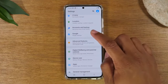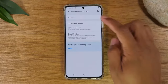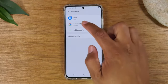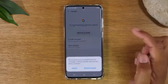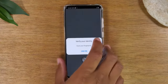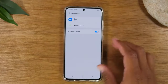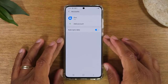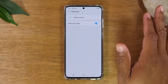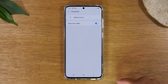From here, we're then going to go to accounts. Look for your accounts and backup tab here. Tap on accounts again. Any Google account you have, simply tap on it. Tap remove account and remove account. Press OK — it's asking me to verify with my fingerprint. For you, it'll either be verifying with the fingerprint or whatever your lock screen passcode is. Now, if you have other Google accounts on the phone, make sure you also erase those as well. You shouldn't have any Google accounts on the phone before you attempt a factory reset.